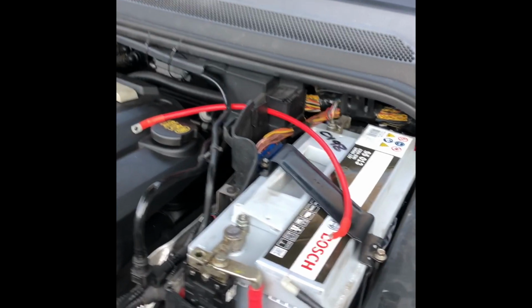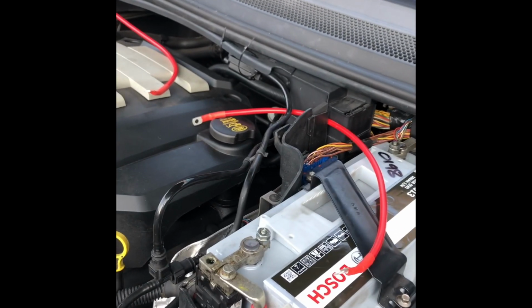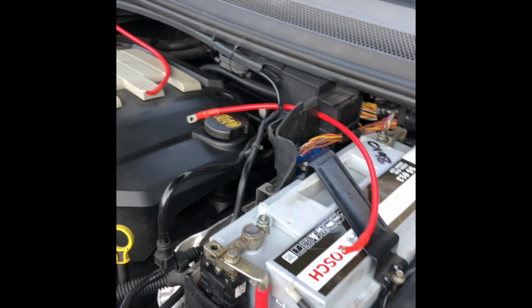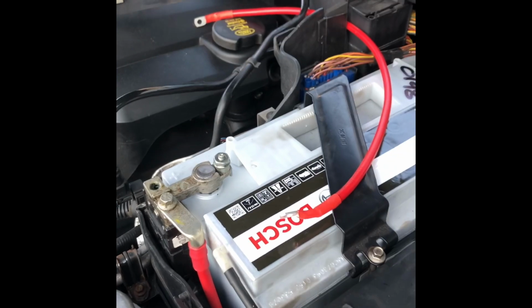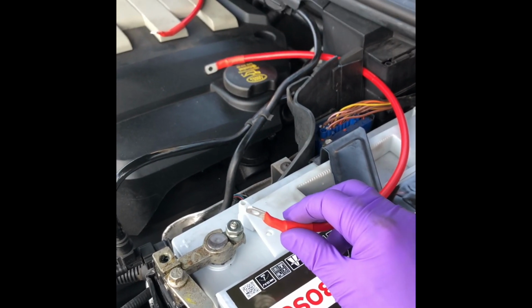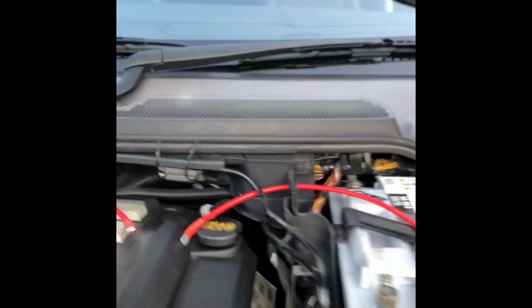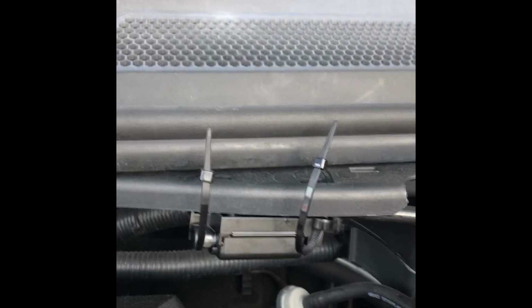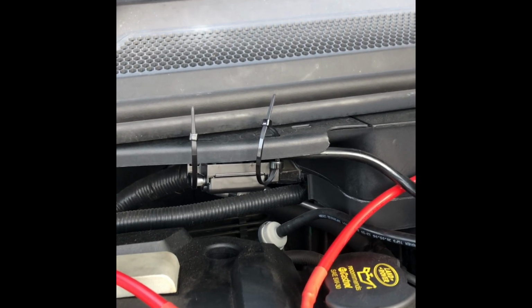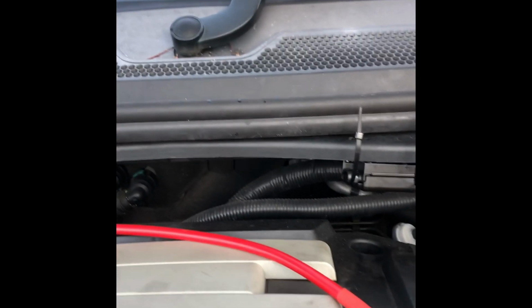What this will also serve as is a bit of an introductory to split charge wiring. So the first thing that you have is your standard battery, your starting battery. I'm going to take one cable here, I'm going to feed that out of the battery box, and to fuse block number 1, it's not tightened down. I'm going to have that roughly about there, I reckon. So cable in, cable out.